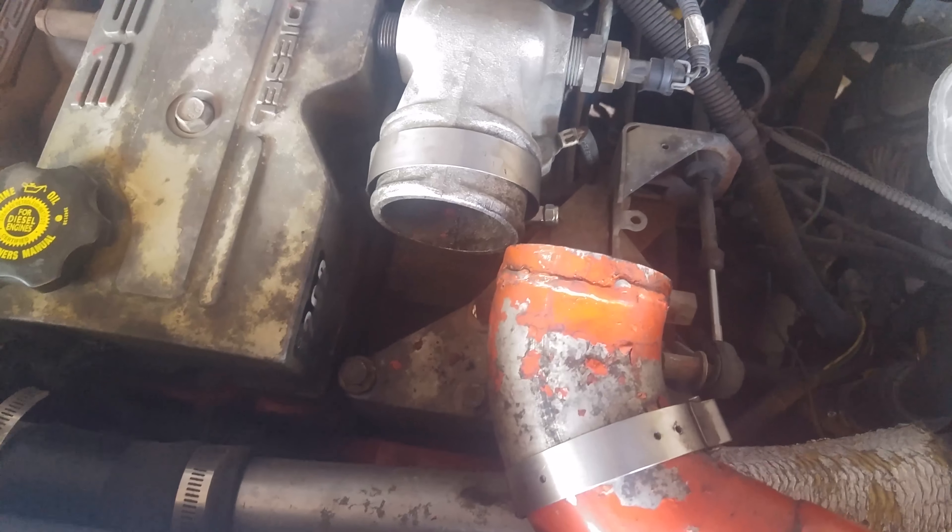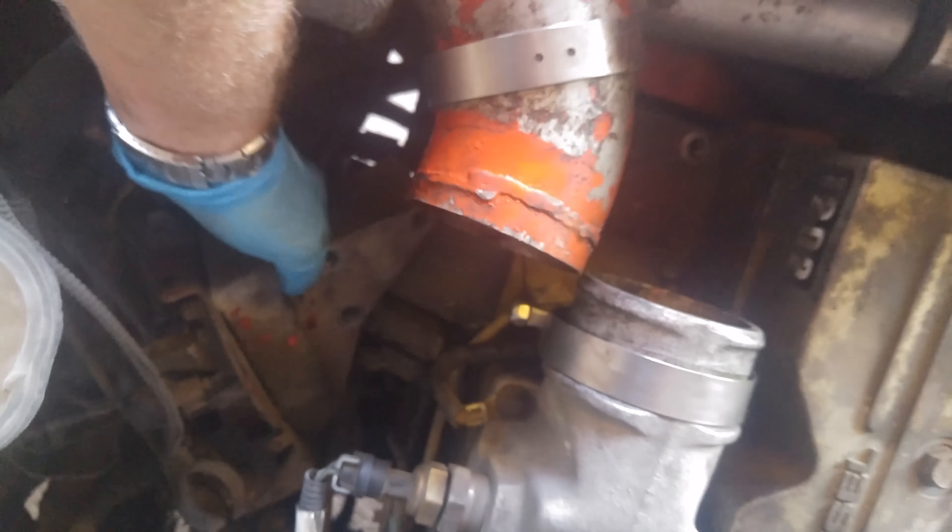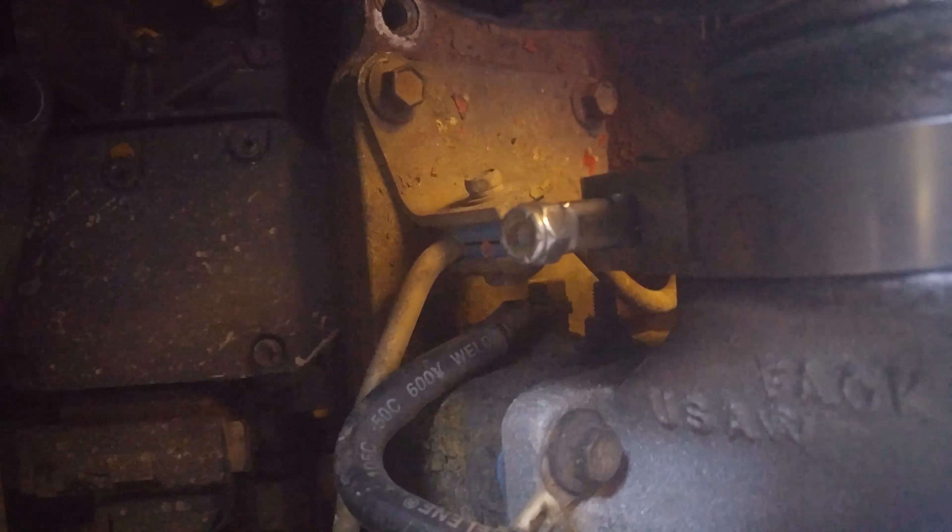The way I have mine configured, I have to take off my turbo boot — this is my intake that I had to make up. I'm going to take that off first and undo the one underneath as well. With the intake pipe out of the way, you undo the three bolts which hold your throttle linkage and throttle positioning sensor in place. That'll give you a clean shot down to the injection pump, and then you can see where you're heading — top of the injection right there.